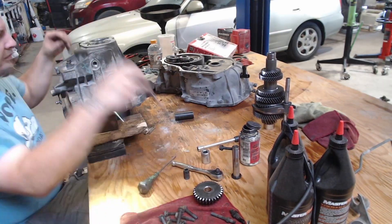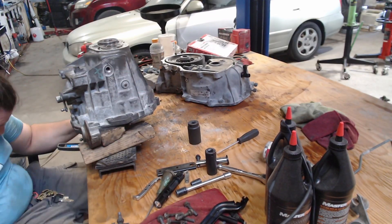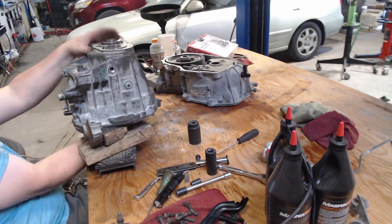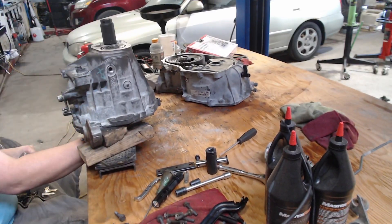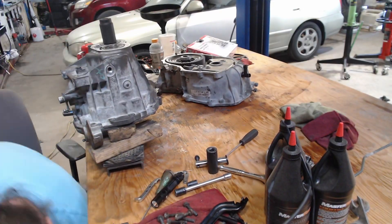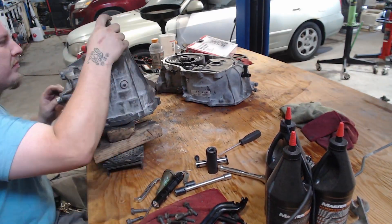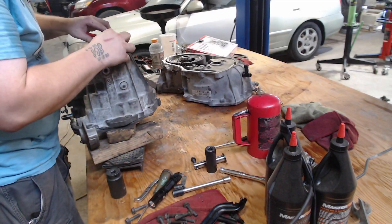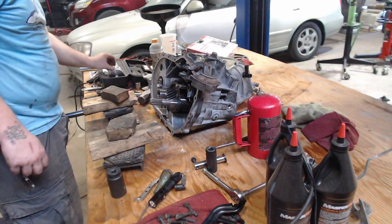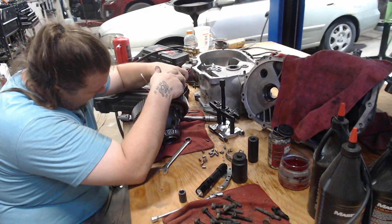You then put the snap rings back into the rear case half so the bearings do not walk. Finding enough materials to use as shims to effectively press the bearings onto the shafts was fun and interesting — sarcastically speaking. The bearings need to be pressed fully down onto the shafts, and doing it with 2x4s and spacers and shims is not the easiest task. I don't know how you would do this with the transmission still installed — I can't figure out how you'd put the bearing back correctly without disassembling the whole thing and risking damage.